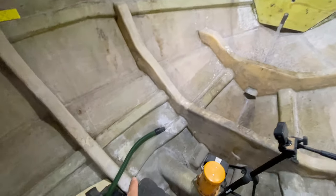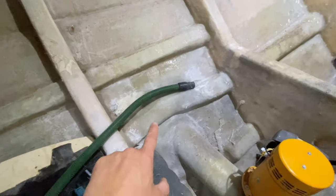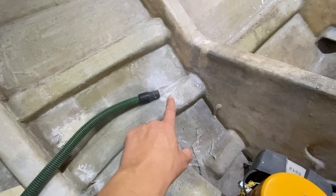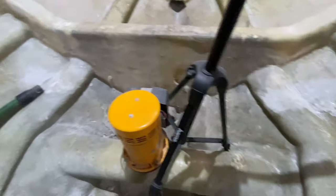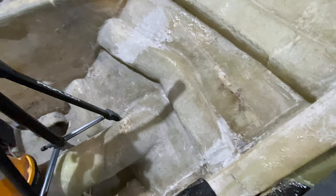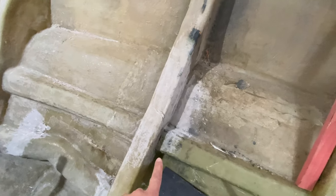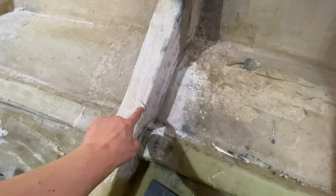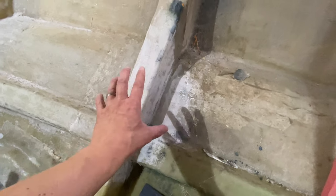And I've also just been cleaning up around this bow thruster, so where the glassing's been added in afterwards. Just clean this up a little bit, got rid of those nasty pokey edges, so that looks a lot better now. And also just put a little groove in here where these cuts were, just so that we can get some resin in here, and then we can get a patch on there as well.